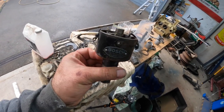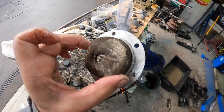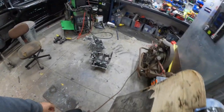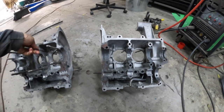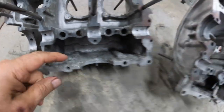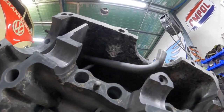I did start playing around with the distributor — it had gunk all over it so I've given it a bit of a clean up. We're going to strip it inside, just make sure all the components are working. The original strainer — I want to use that again because it's factory. We've got some bad news with this case. I've spent pretty much a whole day cleaning both sides of this, but unfortunately we've got two very small pin holes. There is one just there and one just there. If I put it up to the light, you can see light through it. God damn it!